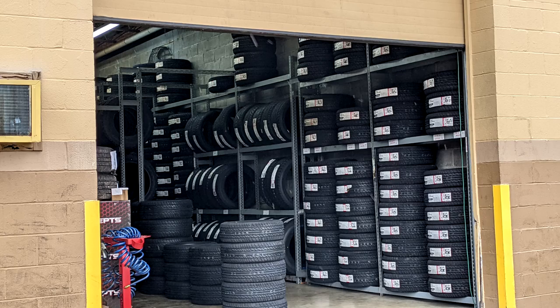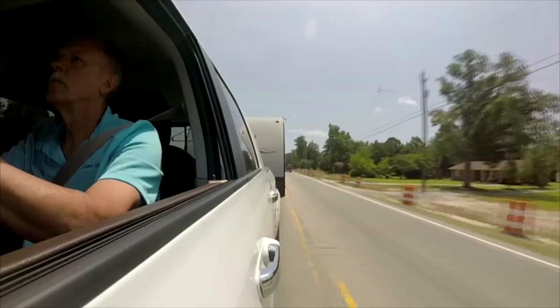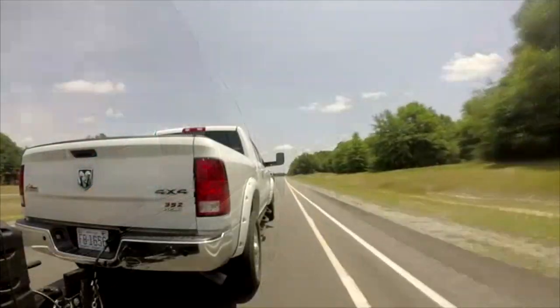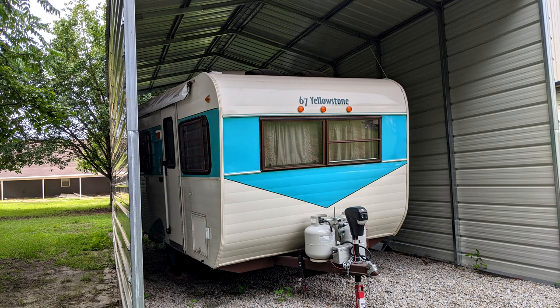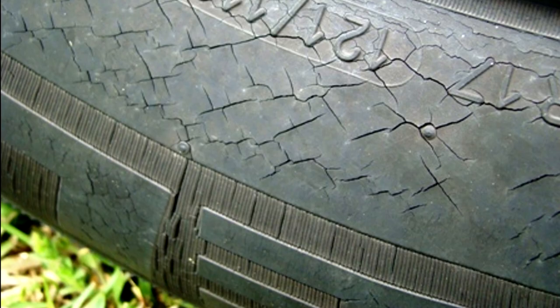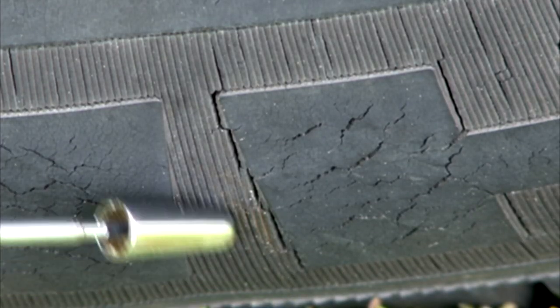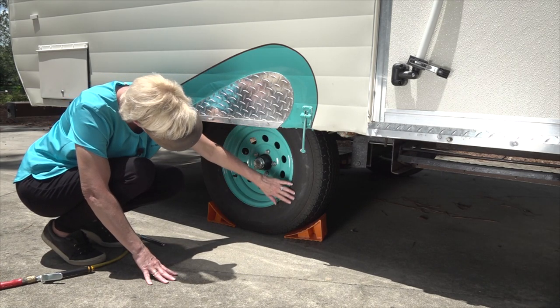Now let's talk about inspecting your tires — visual inspection. When tires are manufactured, compounds are added to help protect the rubber from weather cracking and sun damage, but the tire needs to be rolling down the road, heating up, and flexing for these compounds to work their way to the surface and protect the rubber. When tires sit in storage, they start to dry out, causing the tire to age faster. Weather checking or cracking happens when tires are exposed to heat, sunlight, and non-use — this is especially true of the tire sidewall. Inspect your tires for any weather checking or cracks in the sidewalls before each trip.